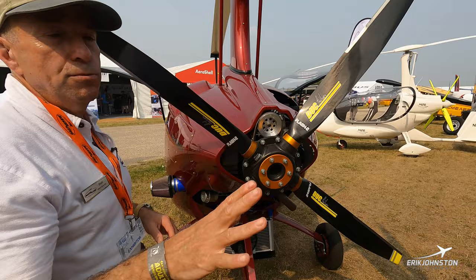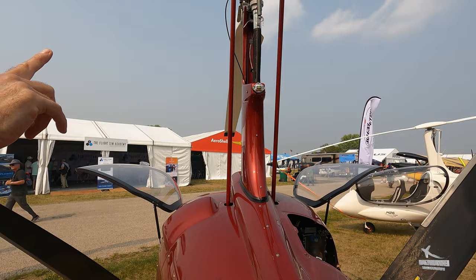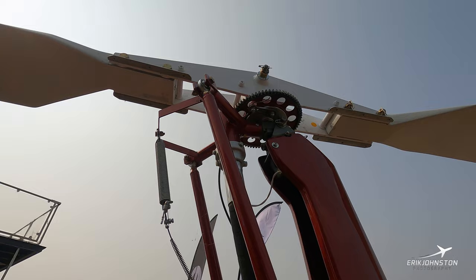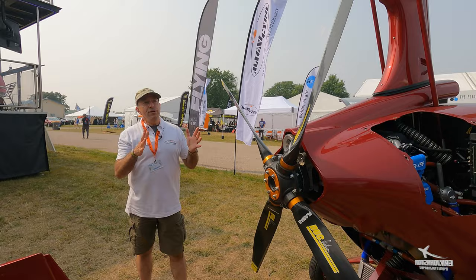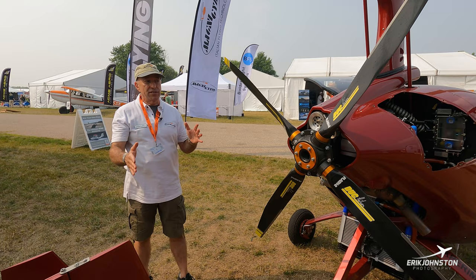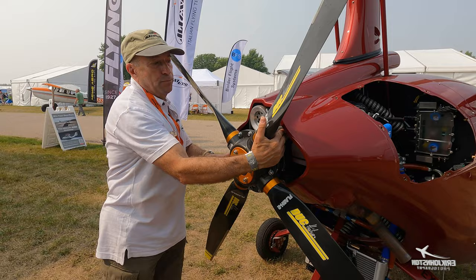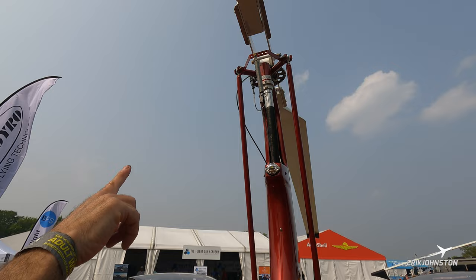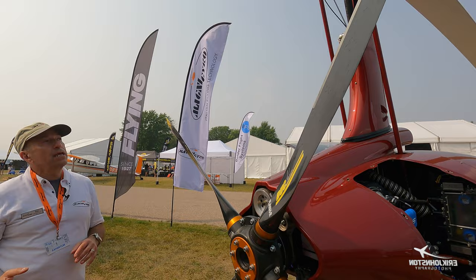In order to take off, there's a thing on all modern gyroplanes called a pre-rotator. If you look up at the top, there's a ring gear just under the rotor. That ring gear has a Bendix drive. When you squeeze the lever in the cockpit, the Bendix drive goes up into that ring gear and actually makes the blade start to turn. The beauty of pre-rotating a gyroplane is that you significantly decrease the takeoff distance — you don't have to speed the blades up nearly as much while going down the runway.